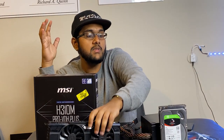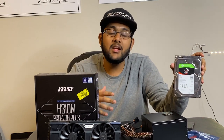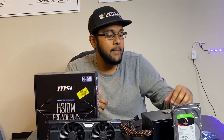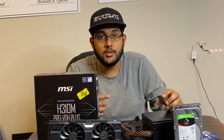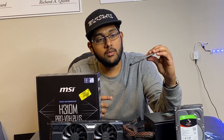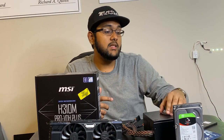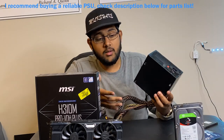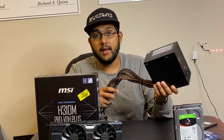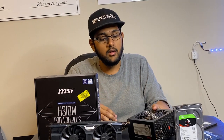To store all your games, I recommend a hard drive. This is kind of overkill — it's about a 4TB Iron Wolf that I had laying around. But any hard drive that's 7200 RPM would work perfectly. You can pick up a hard drive for around $40 for a terabyte, even $20 if you know how to shop. You also want to get an SSD to house your OS and boot drive — this is a 128GB SSD for $20 on Amazon. All this gets powered by a 450W power supply, which you can pick up for around $20. All together, these are around $300 or less if you know how to shop.